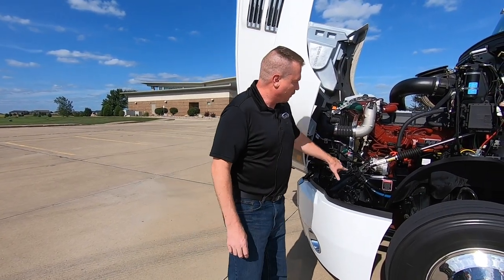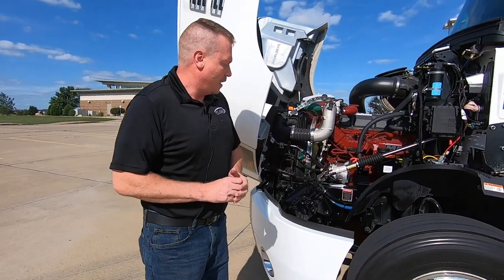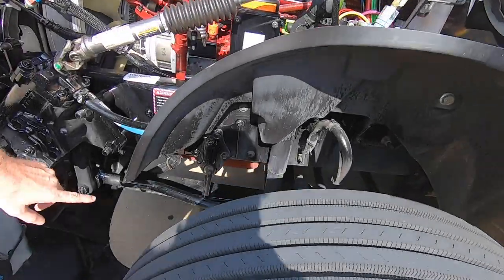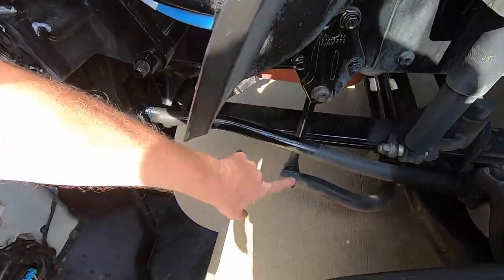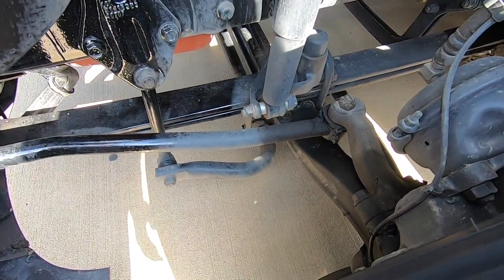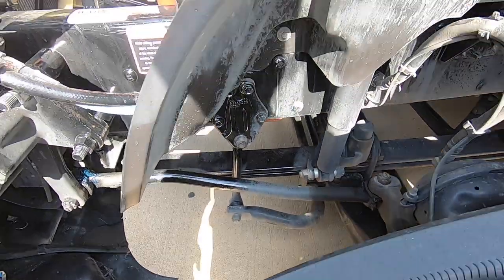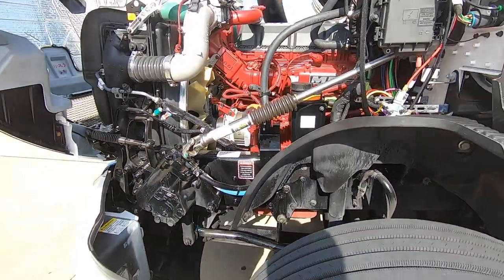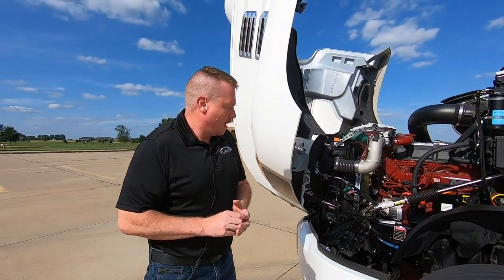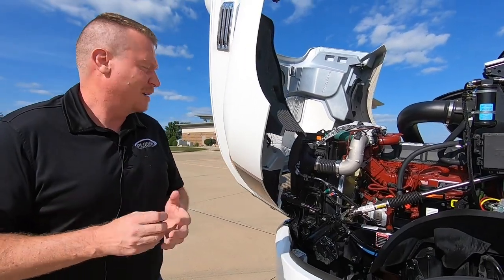In addition to this in the front, we put a 14.6 capacity front axle with a sway bar option. The sway bar, which is right down here, helps to improve stability when we're running the axle up — it improves the handling of the truck when axle up. Anytime you pick an axle up off the ground, you lose a little bit of roll stability. This is building that stability back into the system. We run a heavy-duty shock absorber in the front as well, which helps the handling a little bit.